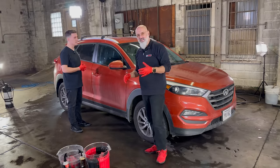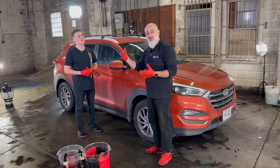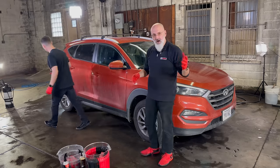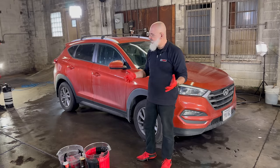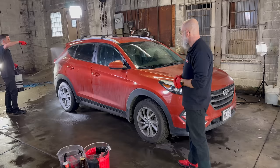We're not going to address the clear coat failure, but where there is still clear coat in good shape, we're going to clean it, polish it, and protect it at the same time. First thing, we're going to be foaming on a combination of All Clean — 15 to 1 dilution in a gallon — and then adding a touch of Incredible Suds for a little more dwell time. There are bird droppings everywhere.